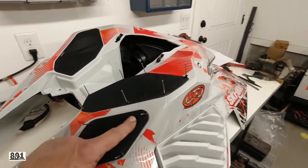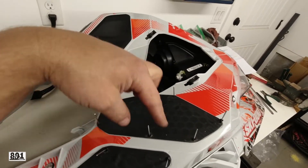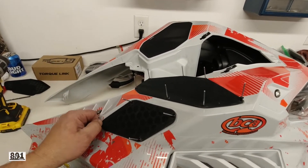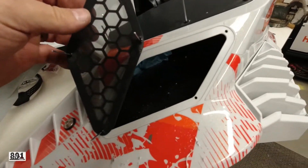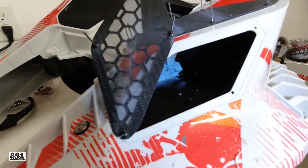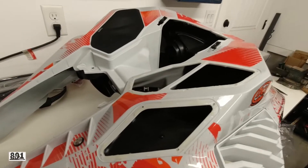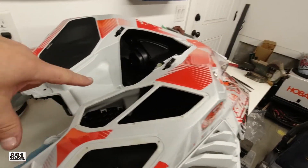It works pretty well — I drill a hole, put a rivet in, and just kind of go crisscross from each other. I haven't done any silicone yet behind this and I haven't pop-riveted them yet because there are still particles in there. I'll grab a vacuum and a light. As you can see in there there are particles, so I'll vacuum it out, take the rag out, and that side's done.